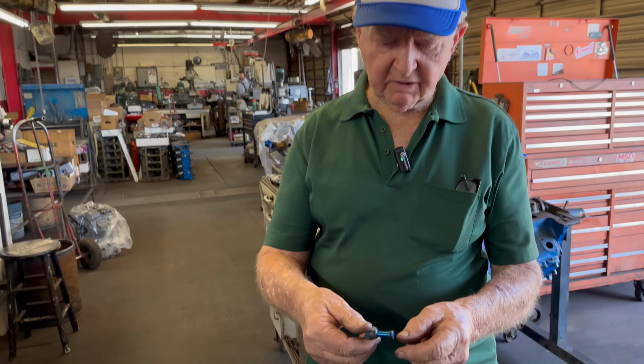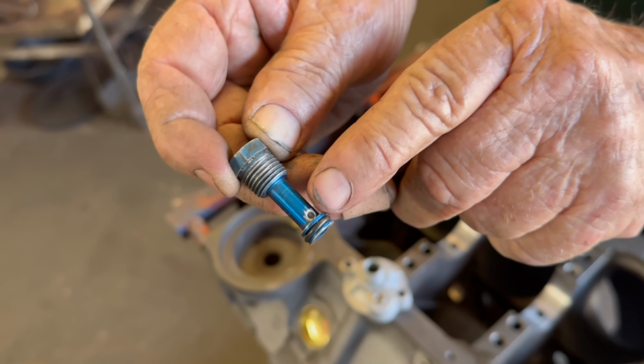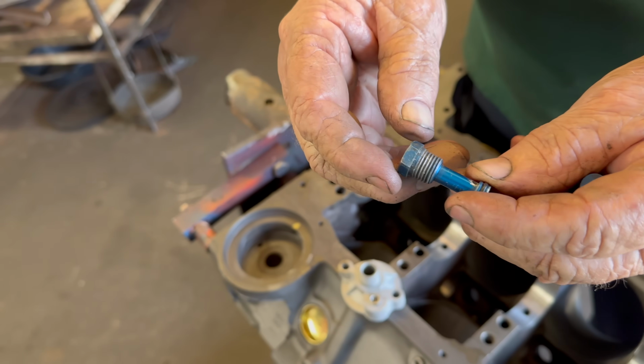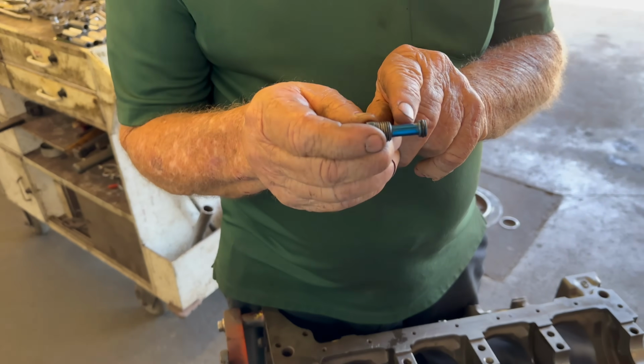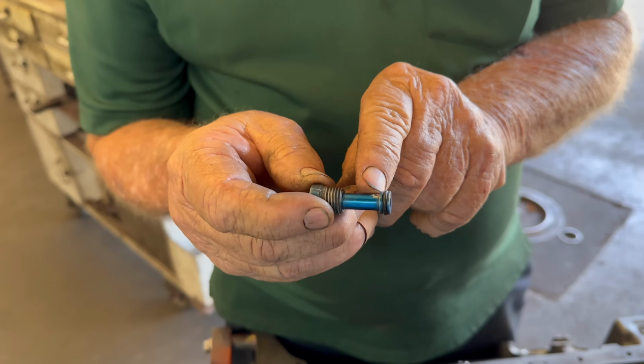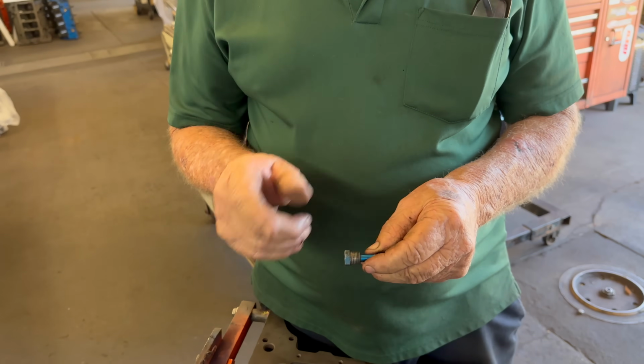There's a little device here. I've drilled this piece of metal, if you can see that or not. Teeny holes in here and a teeny hole in the end of it. These are restrictions that we put in the back of the motor block, for oil going to a solid roller lifter in a bigger race car motor. So it restricts the oil instead of flooding the roller lifters. They're not hydraulics, and that floods the lifters. Is that because the engine was made originally for a hydraulic lifter? Yes. The holes are too big. I got it. This just restricts the lifter area, not the rest of the motor.